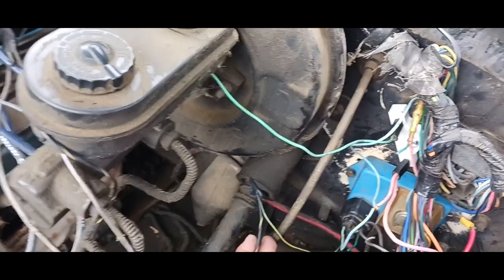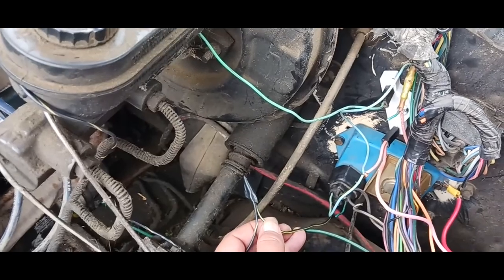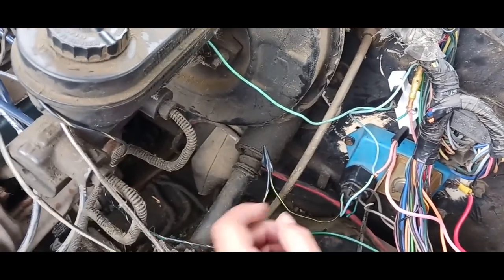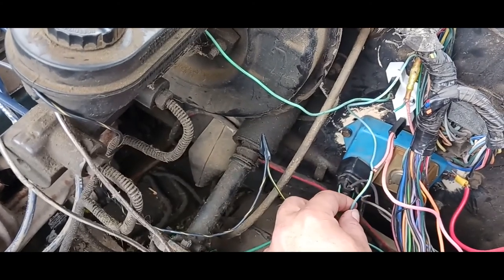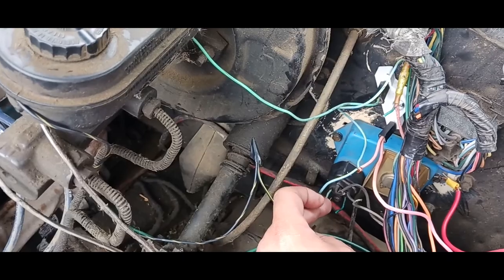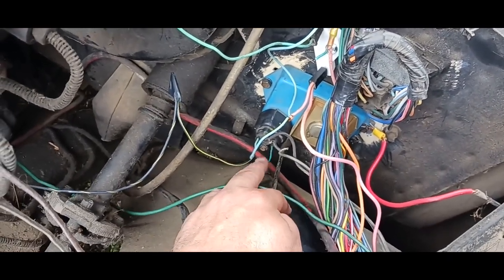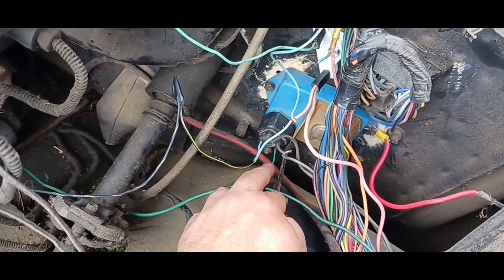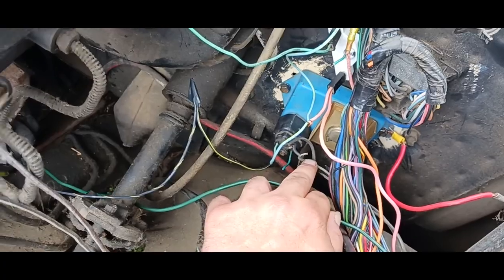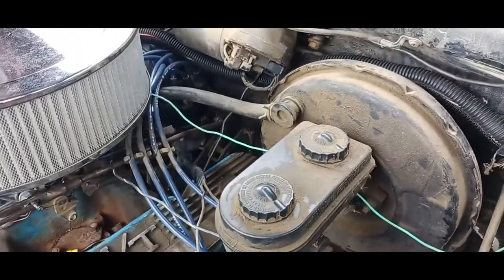Recap: out of the brain box, the black wire with yellow stripe goes to the negative side of your coil. The blue wire with yellow stripe goes into your ballast resistor. This is a four or five prong connector — one wire goes nowhere, don't worry about it. The two remaining wires — make sure you put the right ones in — go to your distributor.